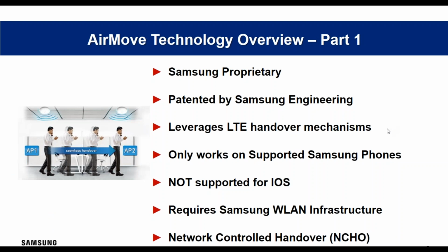The APs themselves have a feature called controlled voice optimization, where the AP recognizes if a voice call is going on, depending upon the codec, and we are voice aware, and then we can change the contention mechanisms. On top of the WMM standard, which we support, we are talking about contention mechanisms that are above and beyond these standards.